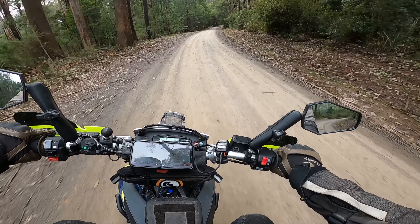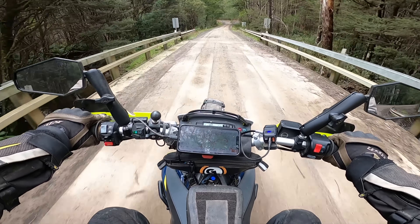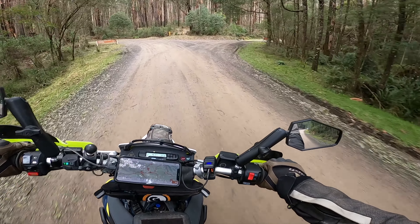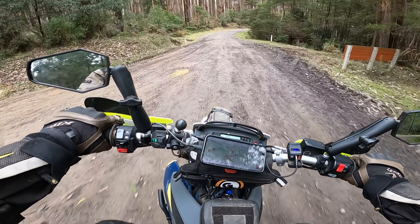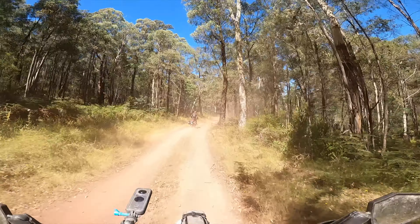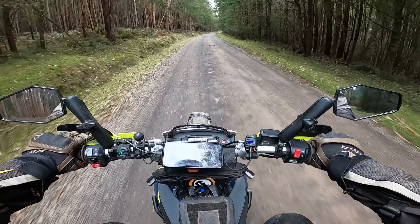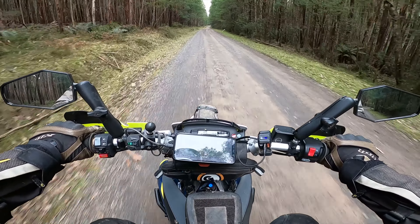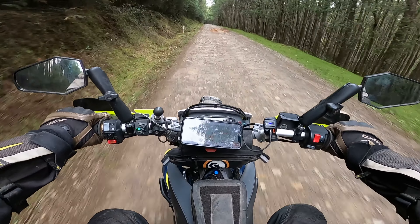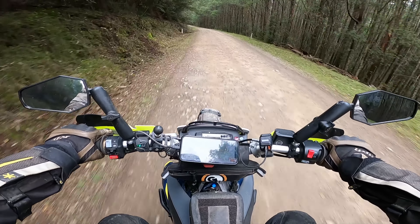Unfortunately I didn't check my airbox thoroughly enough, and there was a little opening on the bottom of it. The bike took in dust — particularly that last trip. I'd been eating dust for the last three days, riding at the back of the pack, and it took in a fair bit. First thing I did was book it in and get them to do a pressure test on the intake valves, and it failed straight away — wasn't getting any pressure. Dirt had got into the motor, so I had to drop the motor out of the bike. Took about three to four weeks.